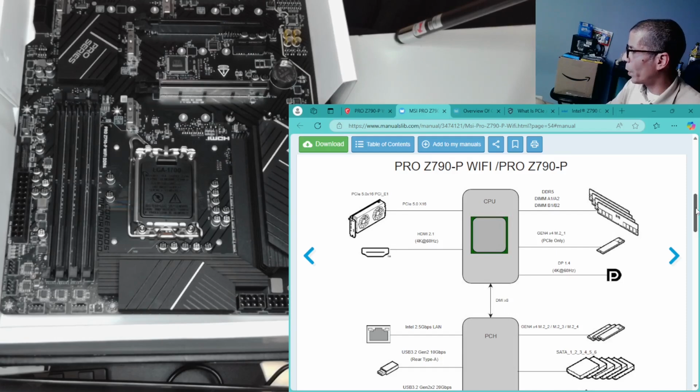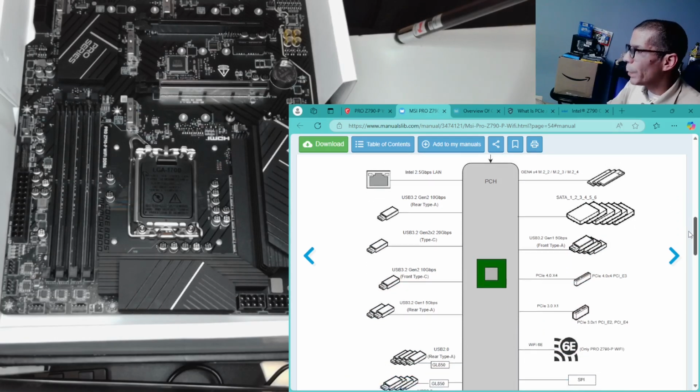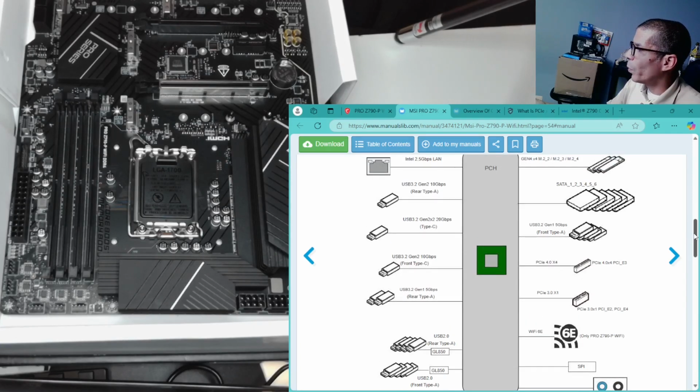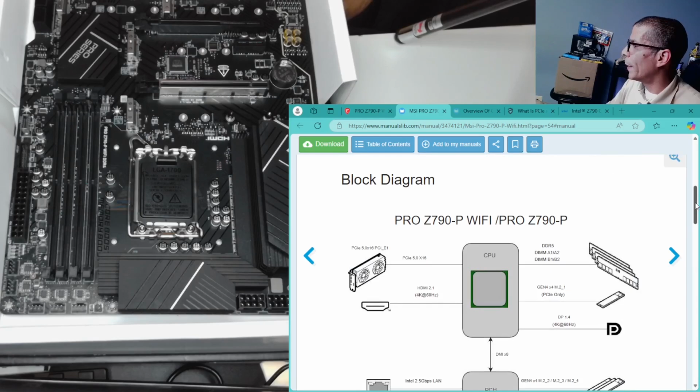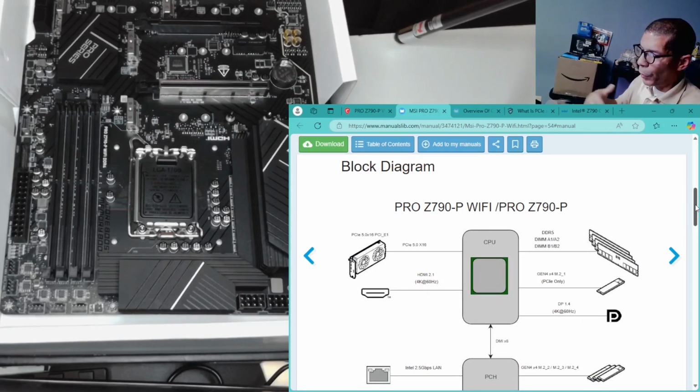The high output would not work. Then everybody else will go into the chipset side, where pretty much they're going to be sharing that side of the drivers, bandwidth, communication mediums, and this particular part of the processor will be tasked with the rest of the components that don't need fast attention of the motherboard, and they will be just fine doing their thing, on a slightly more isolated side of the motherboard. So this picture depicts pretty much that division of who gets access to the motherboard first.